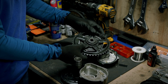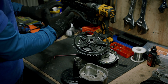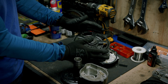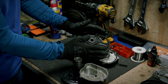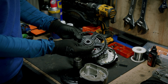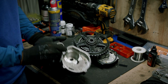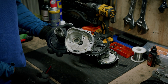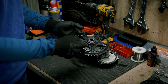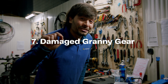To avoid all that, change gears — keep shifting gears so the chain passes freely. If you have engaged a very heavy gear, usually the small sprocket on the back wheel combined with a big chain ring, the motor will struggle to rotate, creating too much friction and eventually causing the bearing to break. To prevent replacing the internal bearing of your pinion gear, always make the chain ring light to rotate.